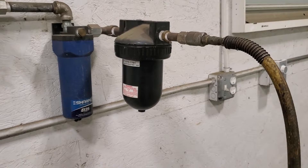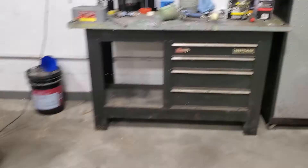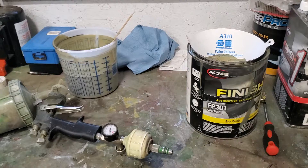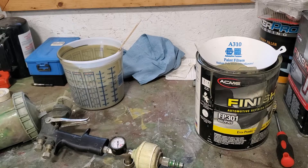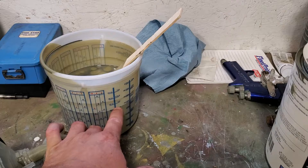There's still a little flash rust — it rusted a little bit — which is fine. It's mainly on the cast iron parts. When you're down to bare metal you use an etching primer. This is what I use — it bites into the steel on bare metal because paint won't bond to bare metal. This etch primer I use is one-to-one, so if you put eight ounces of primer in, you put eight ounces of etch primer reducer.